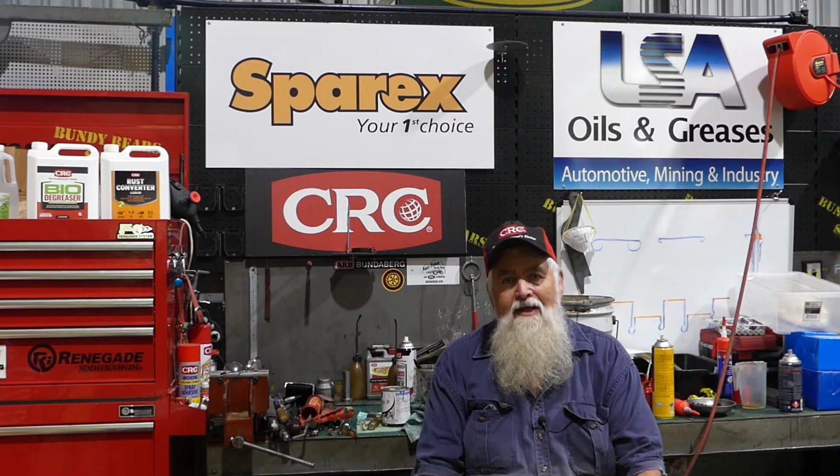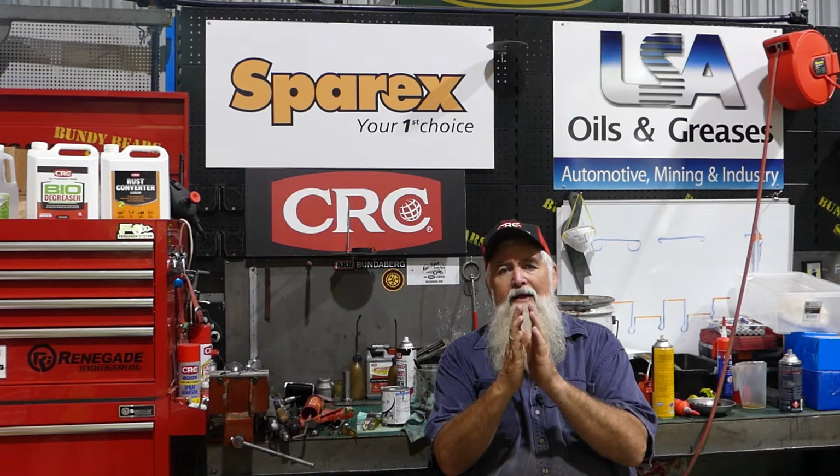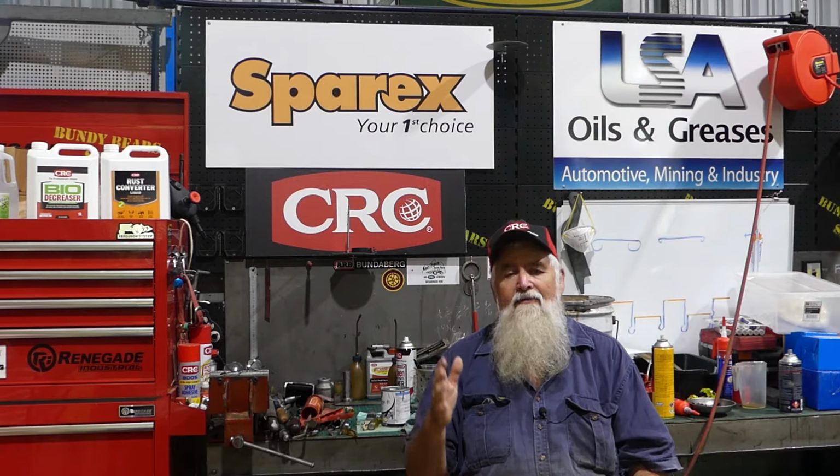I got one hub on, and I got the axle all in, mounted up, one hub on, all the bearing reset and everything. I haven't got the cap yet. We're going to put some of those bearing buddies on that you can grease up, and I'll show you when I get them. You pump grease in and there's a little plunger that just comes up against the spring, and over time it just keeps a slight positive pressure in the hub. So if you don't let the trailer cool down after a long trip when you're backing into the water, that positive pressure is there to stop it sucking water in, and we've got marine seals on the inside of the disc.